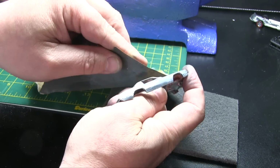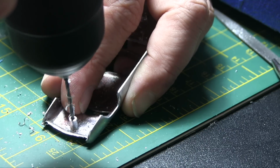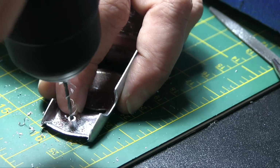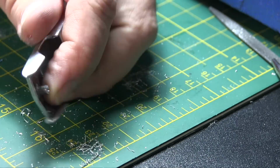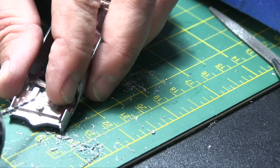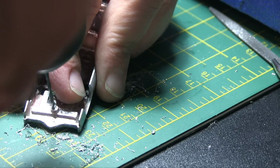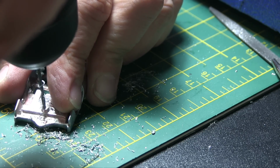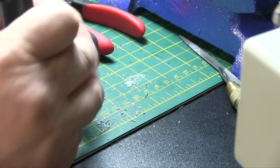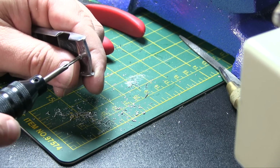And you can use 1005. You can start with, I just started with 1000. Now I'm drilling out the actual post. And I'm using that same bit that I started with at the beginning to kind of get it started for the larger bit. I think it's a 1.5 millimeter. I'll have the exact one in the description, but I believe that's what it is. So be sure you don't drill too far. You don't want to drill into the back of the trunk area or the hood. So you don't want to drill all the way through.